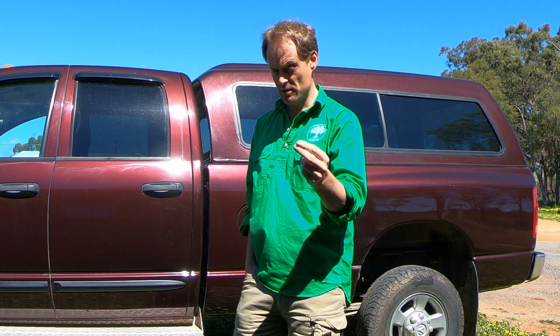So if you've got a Bluetooth OBD reader, and it can read your transmission temperature, then you can have your transmission pan temperature, and if you have a hotline sensor fitted, you can look at both of them. That would be the ideal.